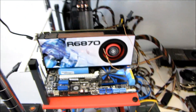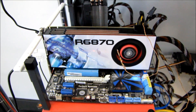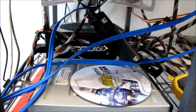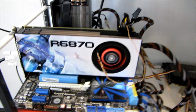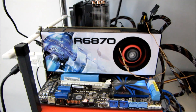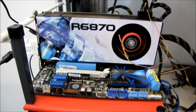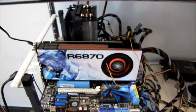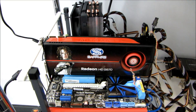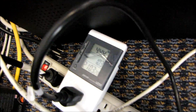Every system is going to be a little bit different, but doing some quick math here — at 90 percent efficiency, we're probably pulling about 360 watts from the power supply right now. As soon as you start adding more drives, that could jump to about 400 watts. Giving the power supply some time to degrade, a 500 watt power supply is probably what I'd recommend for this build.